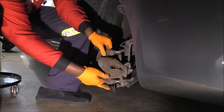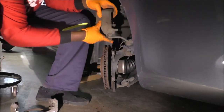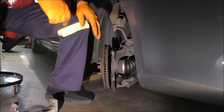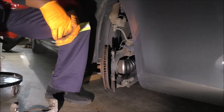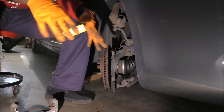Okay, but not very important for what you're trying to do right now, because I had already committed. Thing is, when your rotors are so worn, and we'll examine this one a little closer, you shouldn't just replace the pads, because the rotors are going to eat those pads. And likewise, when you have bad pads, don't replace just the rotors, vice versa.